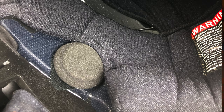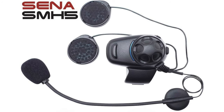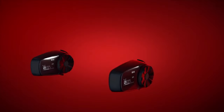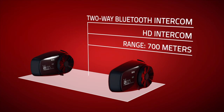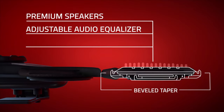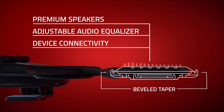You've got plenty of room to put the speakers in the indents for the ears — there's not as much room as in some other helmets, but with the slimline HD speakers there was no problem. The 5S is easy to fit, nice and small and compact, and quite feature-packed. It is essentially a replacement for the old SMH5 but they've boosted it in several areas. It's running Bluetooth 5 and is a two-way communicator, designed to work with a passenger or one other rider, though it does have a shorter working distance compared to other models in the range.